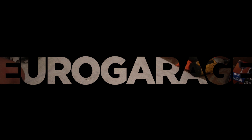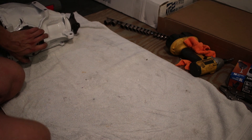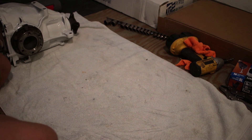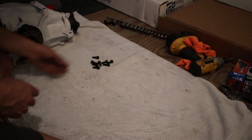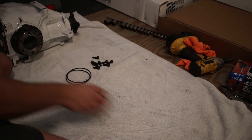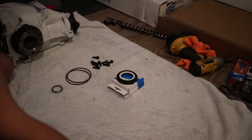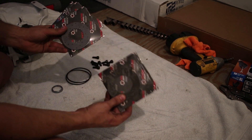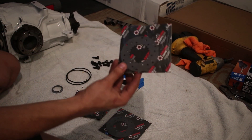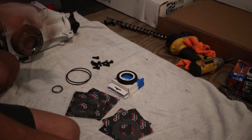Today we're rebuilding the 188293 LSD out of the E30. I ordered a clutch pack — it's a whole kit from Speed Garage Works. He sent me new hardware, new O-rings for the flanges, a locking nut, some seals for the output flanges, all of the dog ear replacements and clutch packs. This is an upgraded kit with more lock, and you use a third clutch pack and just take out a spacer in there.